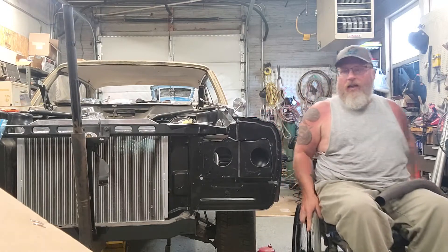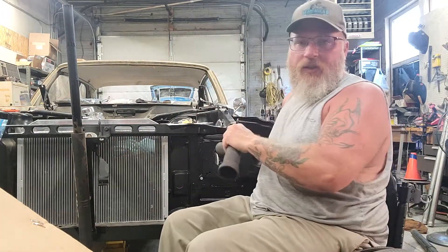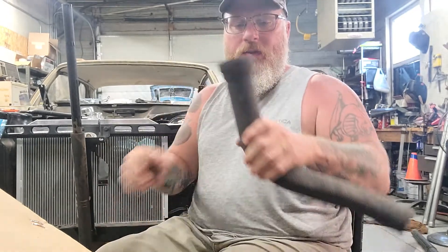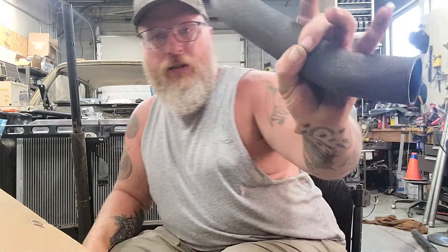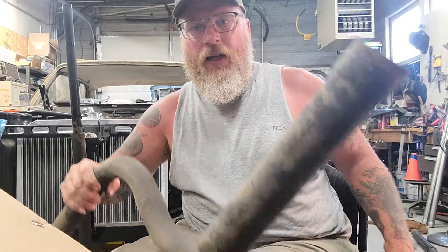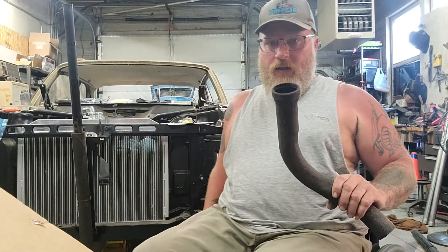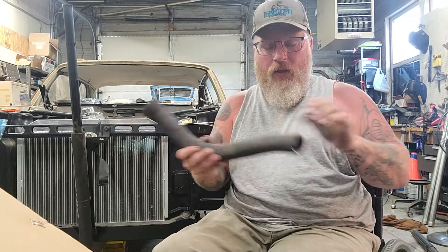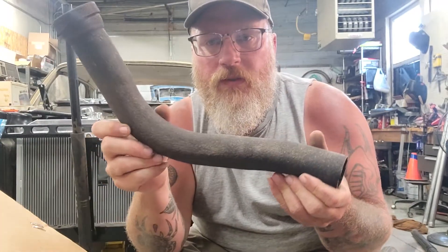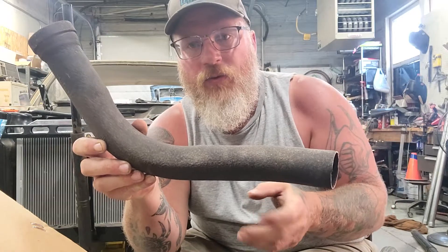It's 82,000 miles on this car — I don't know why I thought it was 60,000, sorry. Anyway, at 82,000 miles this exhaust held up. It is pitted, but what I'm going to do — this is like inch-and-three-quarter, this is tiny pipe. Somebody already cut where it came back together and added a modern piece of pipe. I cut it to get it out of the socket so I can use it for measurements to get my down angle and back for my new exhaust.